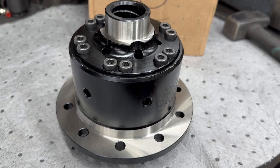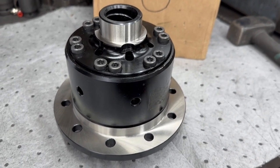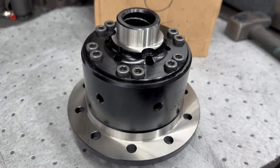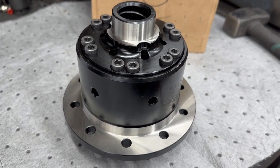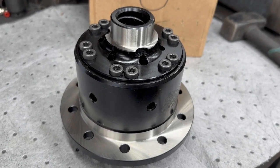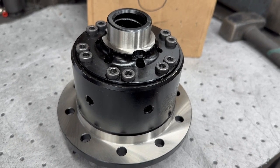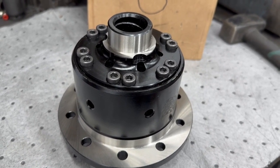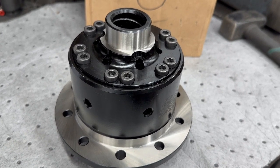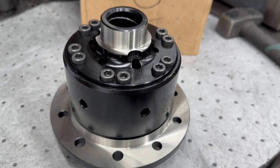This is what we're excited about — I'm so excited I'm almost happy. This is a very special ATB. I'm going to give you a lot of information in a very short space of time. ATB: automatic torque biasing differential — in old money, an LSD, limited slip differential. The difference between an ATB and an LSD: an ATB works by using gears. This one has eight gears inside — six small ones and two drive gears.